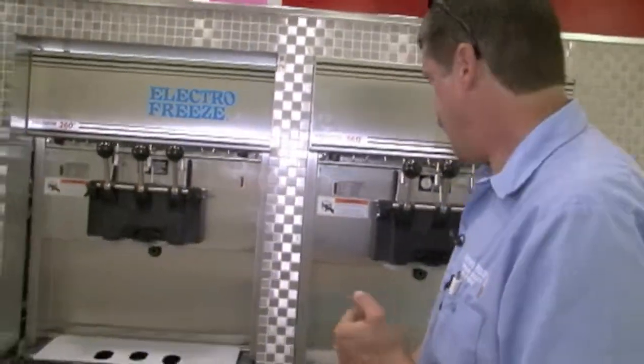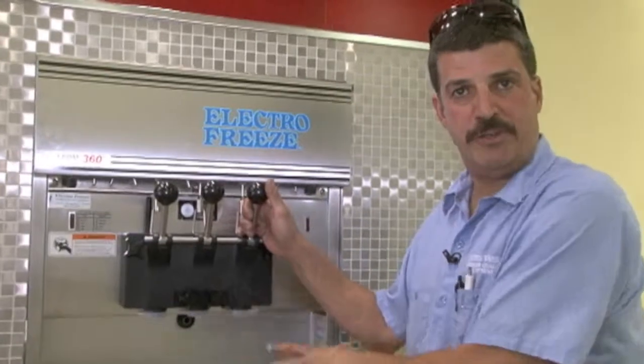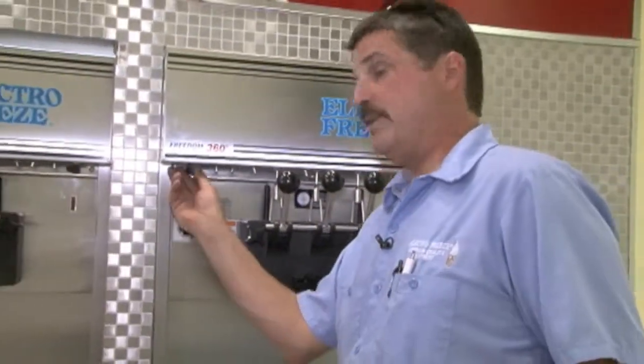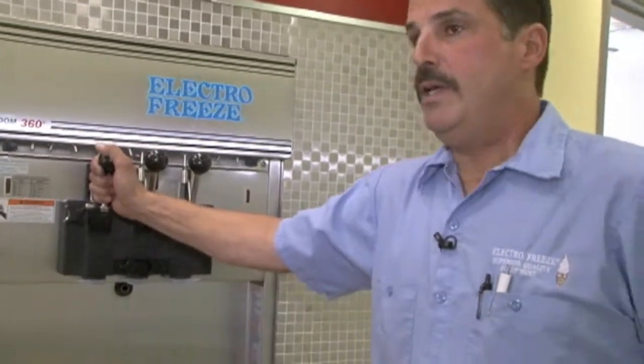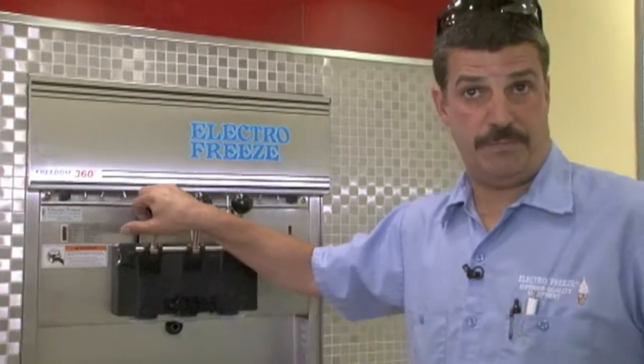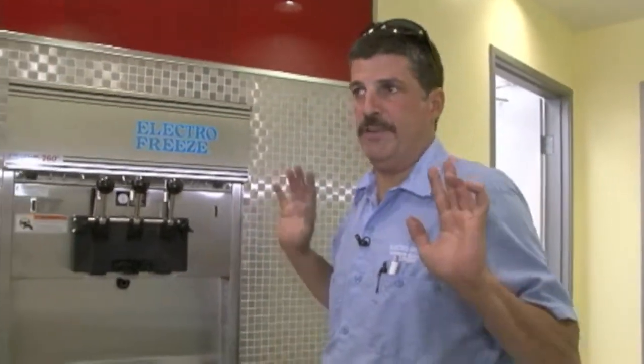That mixes the product and gives you 12 seconds of a bump of freezing. Normally these timers are set up for when you're physically serving product to customers, not a self-serve application — for example, if you saw a school bus full of kids come in all wanting vanilla cones. But as you pull the handles, that compressor's going to run anyway. If you have one serving after another, the compressor's going to stay on regardless. This force freeze is just going to override your thermostat for an emergency — it's optional. Don't use it unless you have to. You can freeze the machine up if you use it all the time for no good reason.